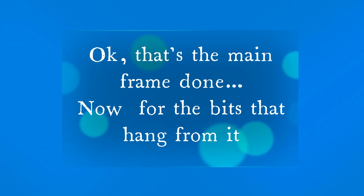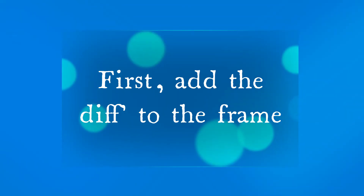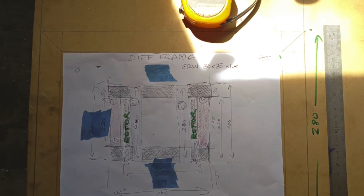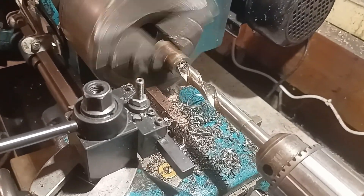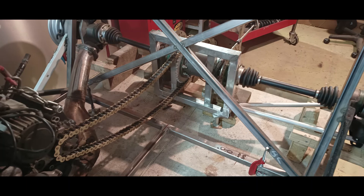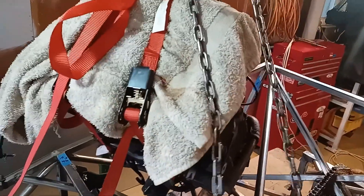The chassis or space frame is just a big bracket that all of the important parts of the car hang off — the diff, the engine, the driver, the suspension. First up, the diff, which is a simple picture frame, although it's made more complicated because the rear suspension and diff bearings mount to it, which required making crush tubes to weld inside the diff frame. The diff frame is then mounted centrally and becomes part of the frame towards the rear of the car. The engine is a much heavier object and required a lot more manipulation to line up with the sprockets and diff.